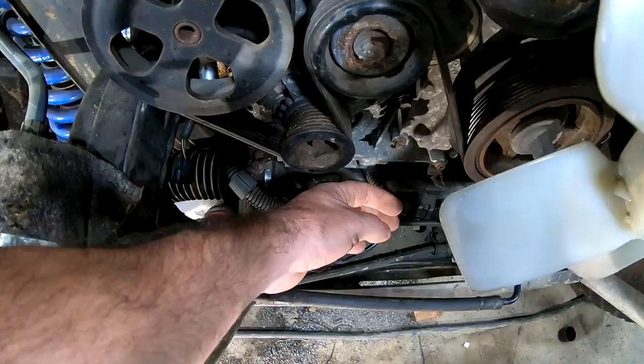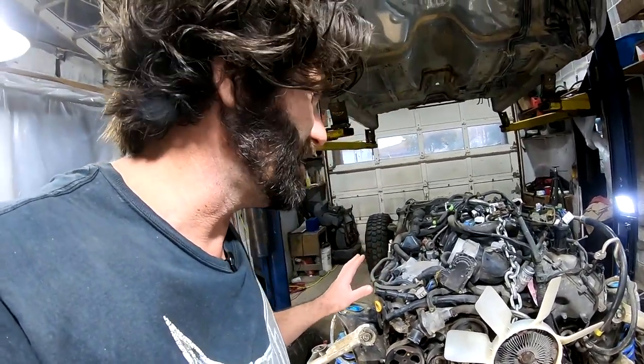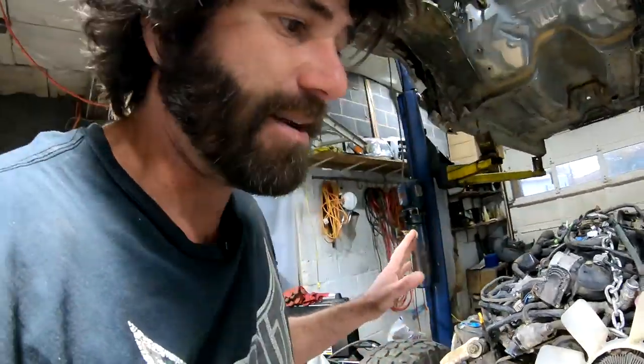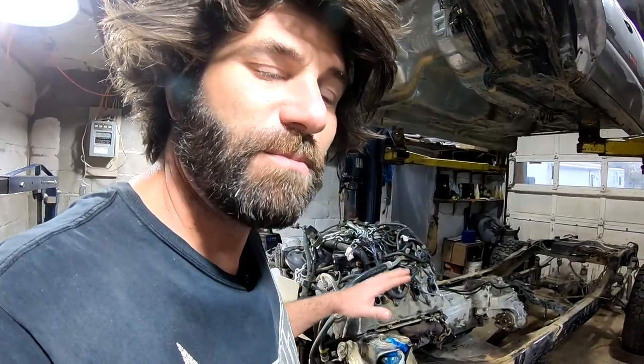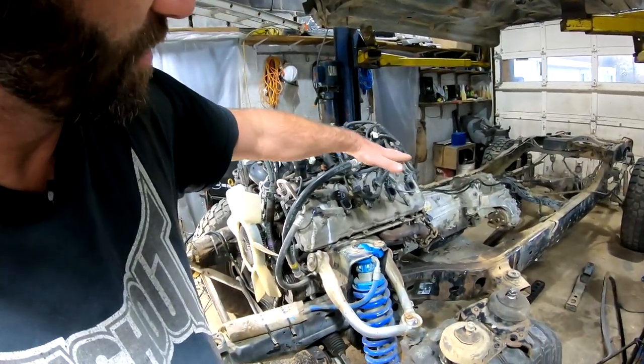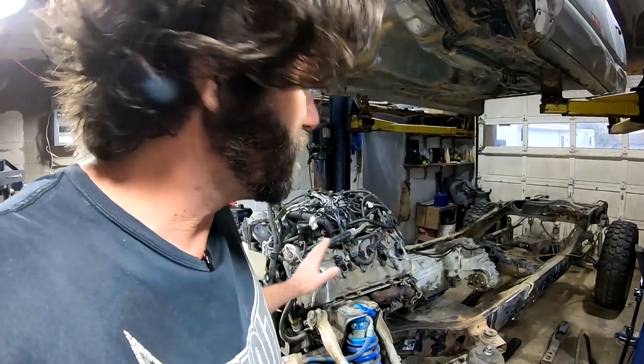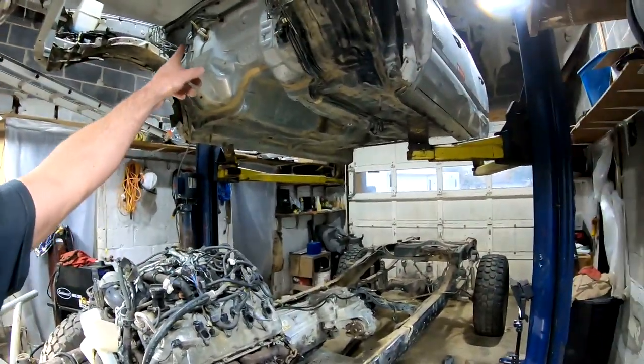In relation to the steering rack, the pulleys are just sticking out past that steering rack a little bit. It actually slid back a lot further than I expected it to, and there's a reason for that. When I originally just dropped the engine in before we pulled the cab, the engine was sitting down at an angle a little too much. Now that we have the whole transmission and transfer case on there, we got that lifted up, tilted everything forward, which allowed the whole engine to slide back further because it's keeping it away from the firewall at the top.